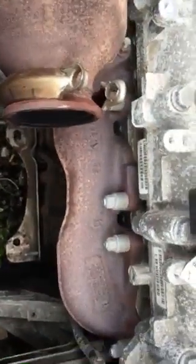Don't be scared of it, guys. You do need to get the car up and you do need to get the belly pan off. There's the belly pan — that comes off with a couple of those quarter-turn screws. You do actually have to rip this front piece off so you can get the whole belly pan down, because otherwise it only just flaps down. But that's not too much of a drama.